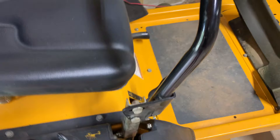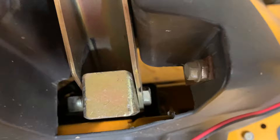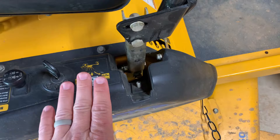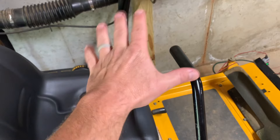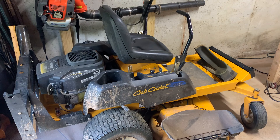Whenever you pull the handles back it disengages the blades, which can cause scalping or scarring in your lawn. Underneath each handle there is a switch — one here underneath this handle and one underneath the other handle. To disable the safety switch that pulls it in reverse, we first have to remove this cover to get to the safety switch. You only have to remove one safety switch because if you pull one handle back it doesn't cut off, but if you pull both handles back it does disengage the blades.